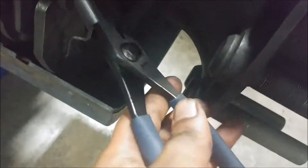These springs here are what's holding your brake shoes together and in place. A quick check on these: you should take some pliers and pull down on them — they should be pretty sturdy, they should fight you, they should still be in good service. If they're wobbling, then it's time to replace those. We've got these two on this side to check out, and then we've got this bigger one, and it's only on one side over here. Same thing — you're going to be checking to see how tight those springs are and how well they're holding up against this abuse.